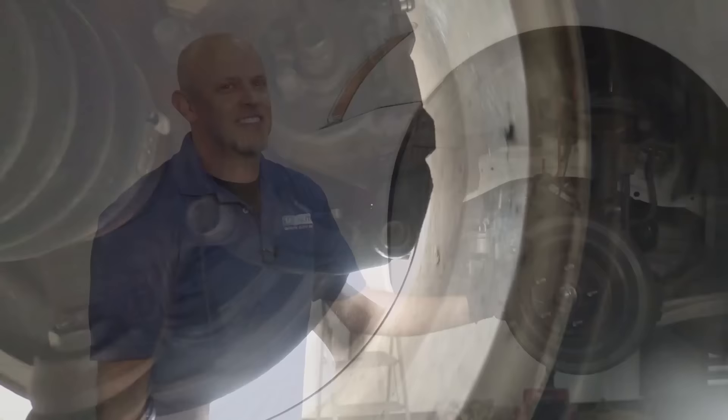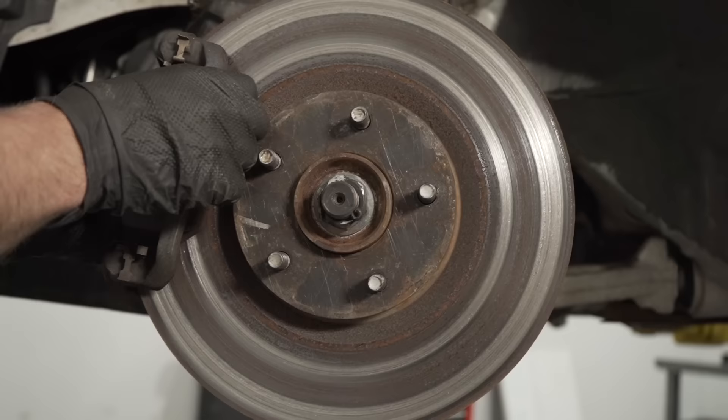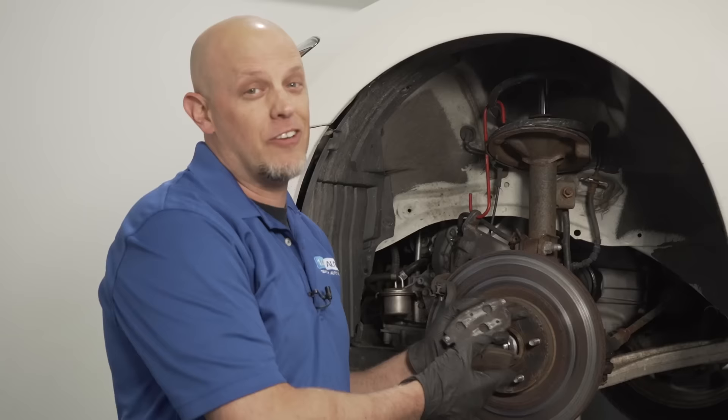Let's look at the damage that was done. Obviously the rotor has grooved because the back of the pads were in there. This was extremely hot — it took a while to let it cool down. There was a lot of hot metal from the back of the pad. If these were brand new and you just did this, you basically ruined everything. You're going to need new rotors and new pads. We were only driving around a parking lot at about 25 miles per hour, so just imagine what this would be like if you drove down the road.